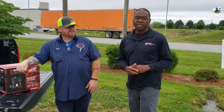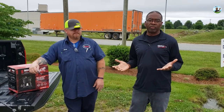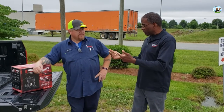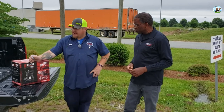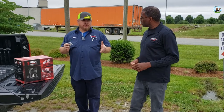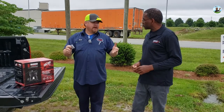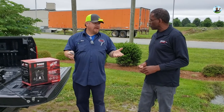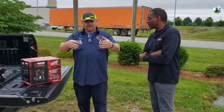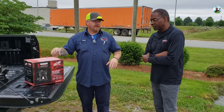He mentioned the compressor kit, but I told him I didn't want a compressor. I want things really simple — I've got a manual pump I carry with me anyway for my bicycle. We're going to have one inlet valve coming out back at your tag. Some people choose two, but it's hard to get both bags exactly the same pressure. If one bag leaks, it's not going to do any good anyway. It's easier to have one valve — when you put 20 pounds in, they both have 20, versus one having 20 and one having 17.